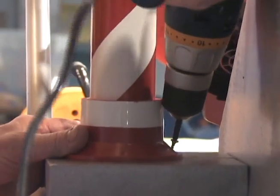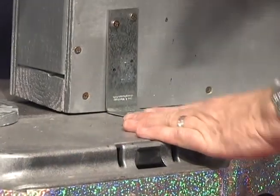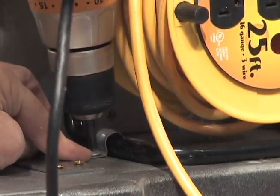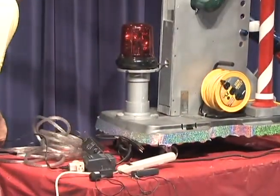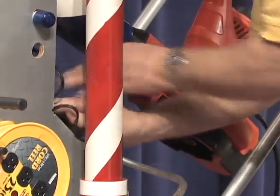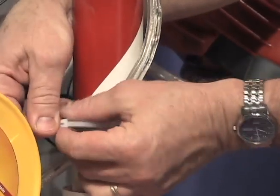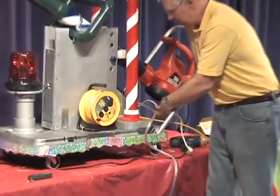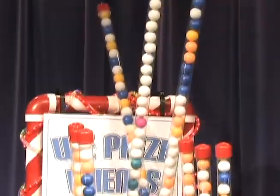Should you ever have to remove the sign apparatus for loading in a car, it's as easy as unscrewing four screws. Attach a five-inch bracket on both sides of the cannon rack to make sure it remains firmly vertical. Attach the extension cord — you may have to use small pipe clamps. Attach the electrical equipment you have selected: this may be a remote control apparatus, running lights, the red rotating light, or sound. There should be ample room to neatly fold the electrical cord within the cannon rack. Wind running lights around the sign apparatus and attach with plastic ties. Another short extension cord can go from the power strip directly to the poof cannon. The power strip can be the only plug that attaches to the wind-up extension cord. Attach a sign of your choosing.